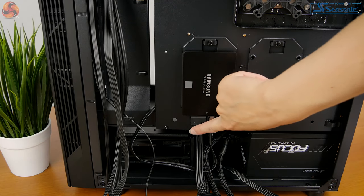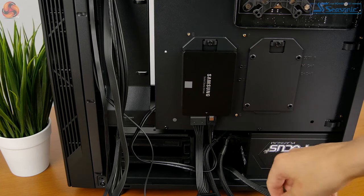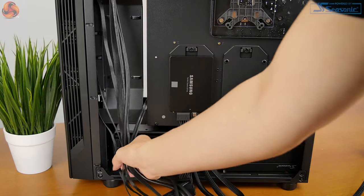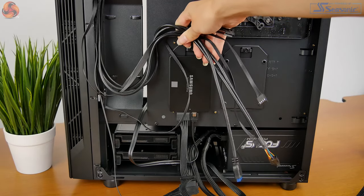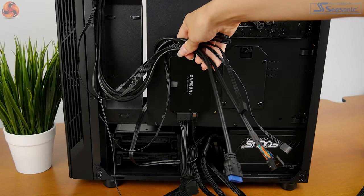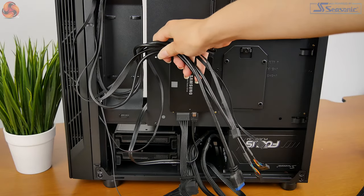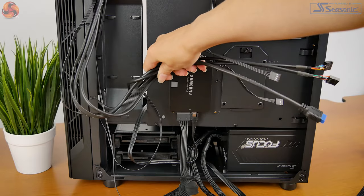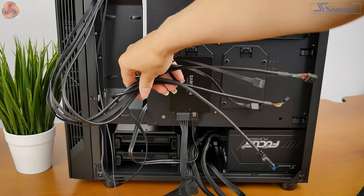Good amount of clearance for installing the two SATA cables. I also plugged in the SATA connector for the RGB lighting on the case. There are quite a few front IO connectors to get plugged in. I'm quite thankful they are nicely coated in black plastic — sometimes in a budget case these are horrible rainbow cables. The USB connectors are the rainbow type, but most of them are black plastic. I'm probably going to have to trail them across the PSU shroud because it only has one slot in it. It definitely makes more sense to have nicely coated cables in a case with a tempered glass panel.